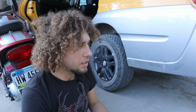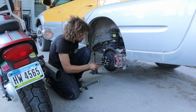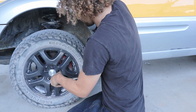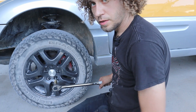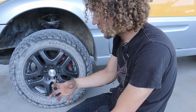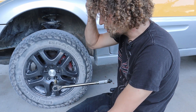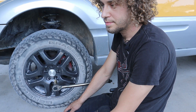It's the next day and I've driven approximately 55 to 56 miles, so I'm going to go ahead and rip this tire off, re-torque the wheel spacers, re-torque the wheel. That one actually moved quite a bit, which is another reason why you need to re-torque your wheels after 50 miles, because we are initially seating those pressure-fit studs into the casting. It might not have been a problem at all, or it might have been a problem down the road, but we're not going to take chances. We're going to re-torque everything, and I might even re-torque these again after a couple more miles just for my own peace of mind.